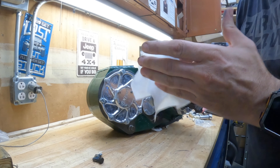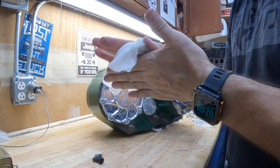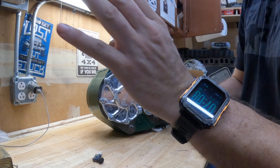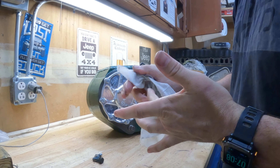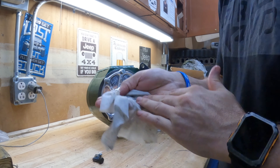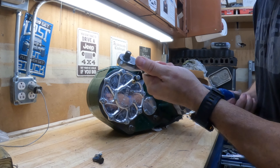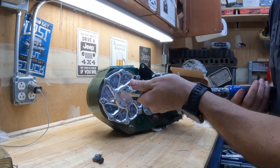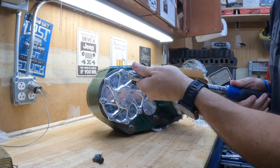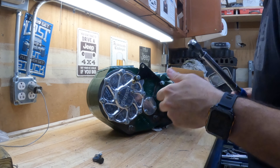First it wants me to move these two 9/16 screws. I've got these 9/16 one-inch bolts — it does show lock washers. We are going to put them on anyway. I'm just going to lube these up because I pulled them out of through-bolted holes. I want to thank Ulsa Tools for sending me out these wipes — they're amazing, they smell good, they clean really well, and they're not just for hands, they're good for tools. I cleaned some of my interior with these. I believe this torque spec is 30 foot-pounds.